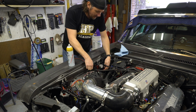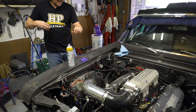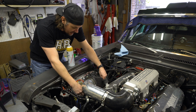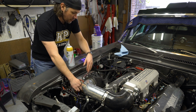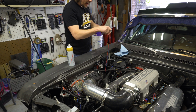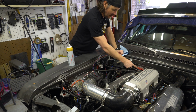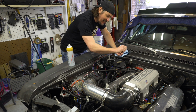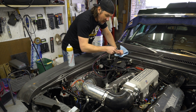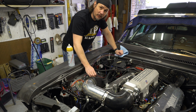Now it's clipped in. So we've got our ground wire that we need to tie in. I've actually got a bus of ground wires over here that I'll route this around, probably underneath everything, and go right to that bus where that fuse panel bus is. And then we have our circuit, which is way longer than we need because we're only coming over here to grab this lug right here. So let me go hit the disconnect switch on the back so we can unbolt our power lugs here, and then we will dive into terminating this and crimping it so we can hook up our amp meter. Then we'll set it up in the software.